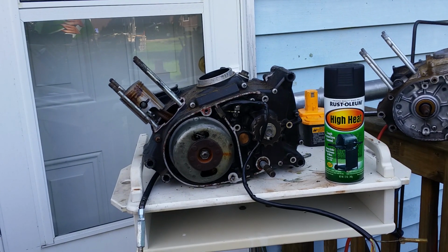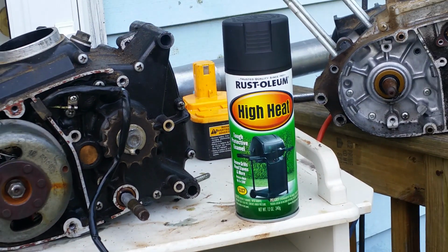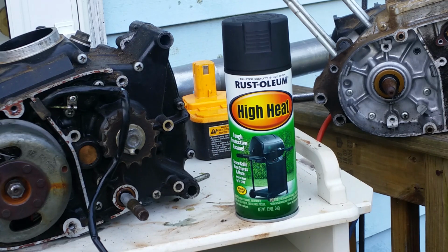And the paint that I use whenever I do anything like this is a high quality paint, and Rust-Oleum makes a great paint. This is high heat and it's good up to 1200 degrees. Now if your bike hits 1200 degrees, you're going to be replacing the bike. It's that simple. Your exhaust does get hot. It does sometimes get up that top, but these two strokes run pretty cool for the most part, even when you're hammering on them. Of course, you wouldn't want to touch the exhaust to find it out, but it does pretty well on the exhaust systems. I'm very happy with it.